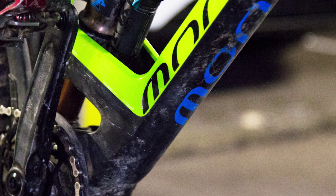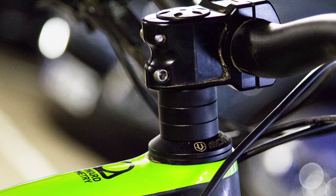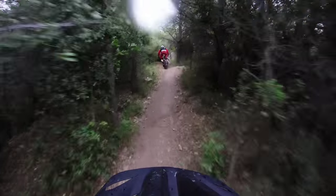One of the problems I had with this bike was a rock strike during practice. A rock flipped up from my front wheel and hit the downtube, leaving just a slight crack in it. These bikes aren't supplied with a downtube protector, as a lot of carbon bikes are nowadays — I really think that would be a good thing and Mondraker should be supplying them with one. Another thing I found is that I couldn't get the bar quite high enough, even with the slightly higher rise bars I fitted. The front end felt a bit low when tackling really steep, rocky terrain.